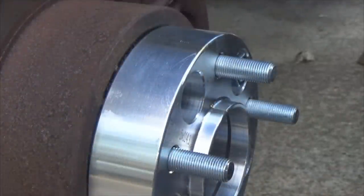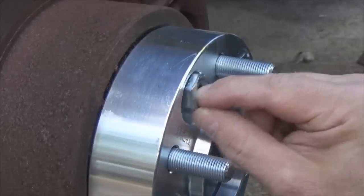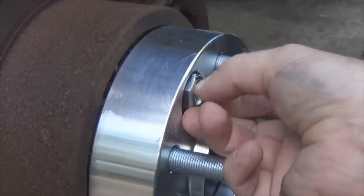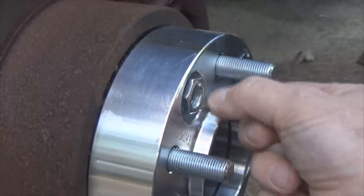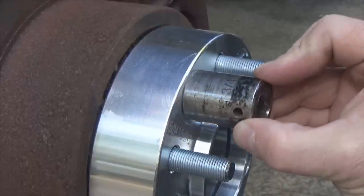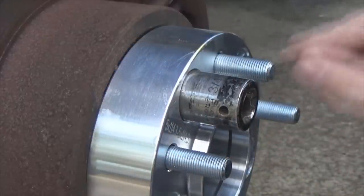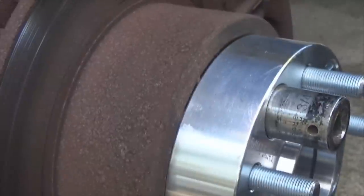Now, if you guys remember a few moments ago, I mentioned how many revolutions of engagement the lug nut needs to have. It was 8 revolutions of engagement, a thread that it must bite hold of in order to be safe. Okay, let's get the threads to take hold. It's almost there. Okay, we got a little bit of engagement going there. So right there, see, I can't pull it off now. So it means the threads are starting to engage with each other. And see, it's a 13/16. Take my 3/4 socket. What I'm going to do is rotate that socket and count my revolutions. I must have at least 8 full turns in order for that lug stud to be long enough for safety. Whoops, hit the camera.